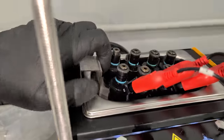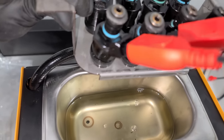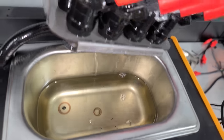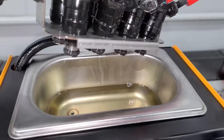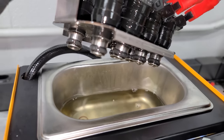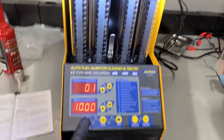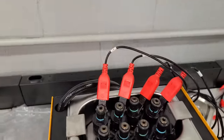The timer just went out. Yeah, we definitely have some stuff going on in the cleaning tank — and we really blew these things out with compressed air, so none of this is from the outside body of the injector. It could be little pieces of debris from the O-rings. Now we switch the connectors and start the second batch. While the machine is cleaning the last four injectors, let's fix the fuel leak on the rail.